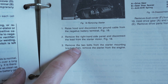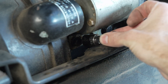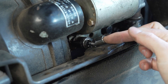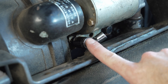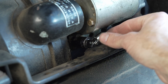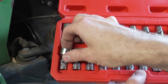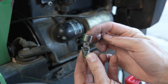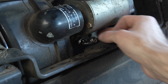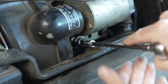I love how it says in the manual, just remove the bolts and then remove it from the engine. That's a little easier said than done, John Deere. These bolts can be accessed with a normal socket and universal swivel, but it is still a little bit crooked on the bolt. So if your bolts are pretty stuck like mine were, it might not be good enough to just use the normal socket. So I went ahead and bought a set of shallow universal swivel joints - just the swivel with the nut as one piece - and that allows you to get that socket all the way onto the nut and break it loose.